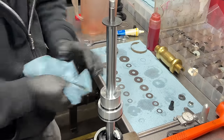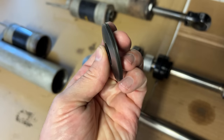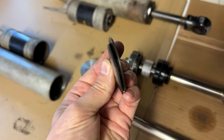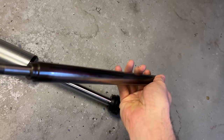The Fox also have this nice rubber bumper to soften the blow when the shocks are fully extended. I didn't see this on any of the King shocks nor the Icons, though the Icons do have a couple of beveled washers that will act like a bit of a spring to lessen the impact at full rebound. The shaft of the Fox shocks is also much harder than the King's, which will help prevent rock chips and dings that will kill your seals.